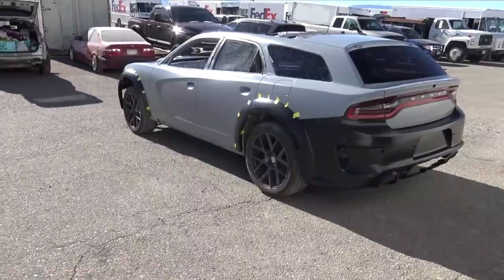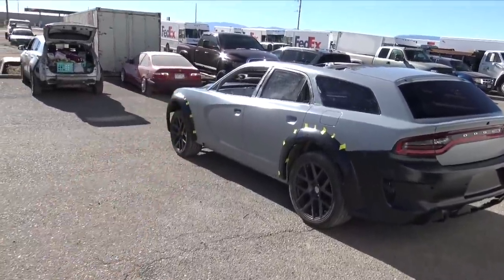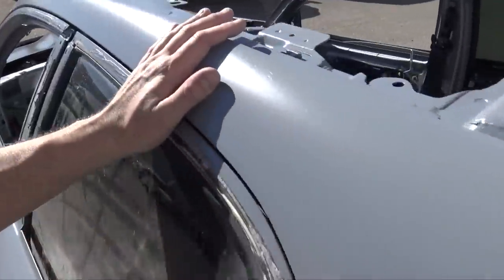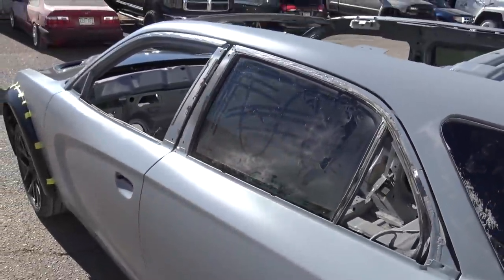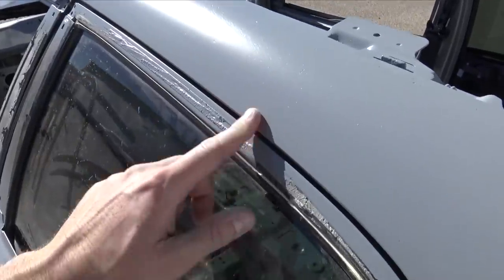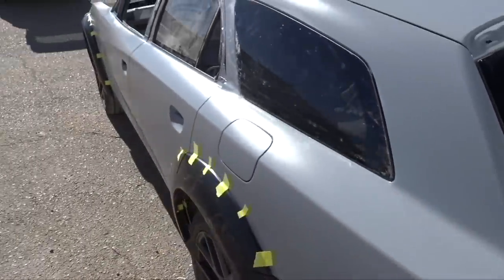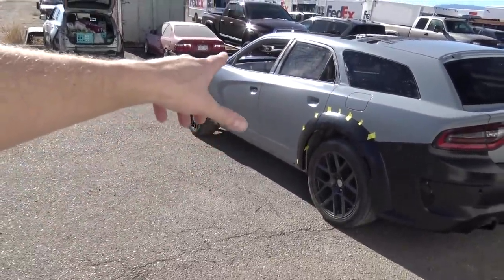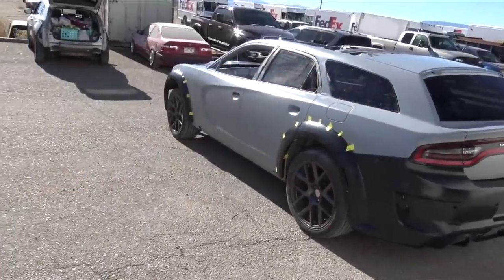and now we can let it sit outside and bake in the sun, and all those sanding scratches will shrink, the primer will shrink into them, block this baby out, and start filling in some of these pinholes from the body filler in certain spots, and then we'll just kind of get her ready for paint and continue the fabrication process. But yeah, I can't believe she's in the stage already.